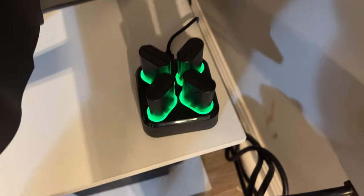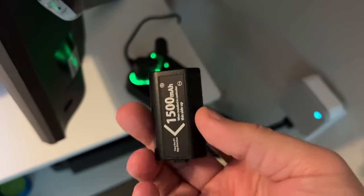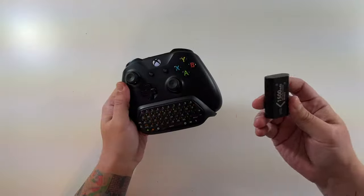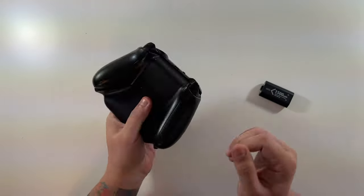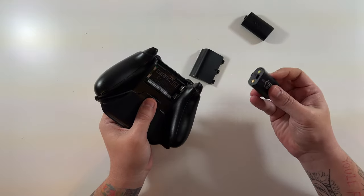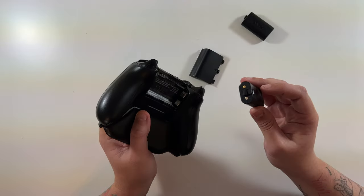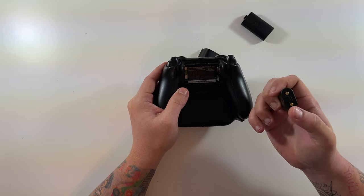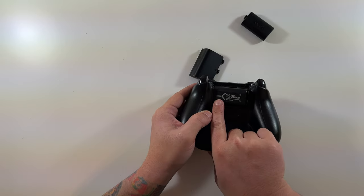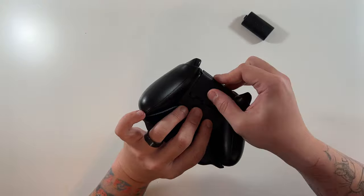I'm going to slide one out. Now I have the battery in hand — let's pop it into an Xbox controller. The controller is currently showing about half battery, so let's see what it looks like once we get the new battery in. Pop the back off, take the old battery out, and insert the new one. This little indention guides placement — take the end with the two connectors and the sticking-out plastic piece, put it down in the controller. It actually says 'face to RT key direction.' Push the other side in and the battery is in place. Put the plastic cover back on.